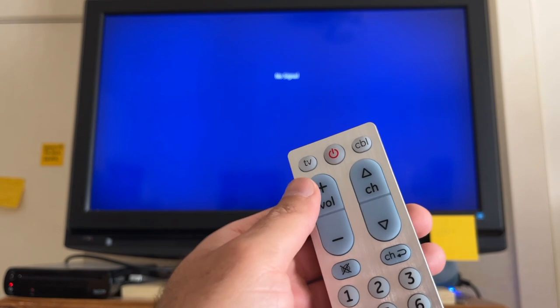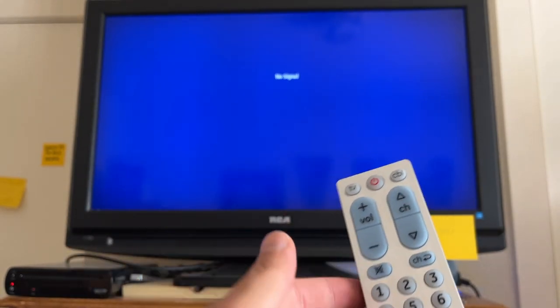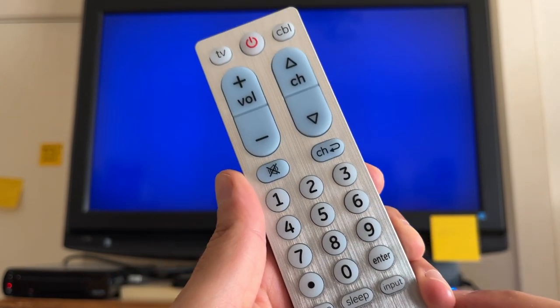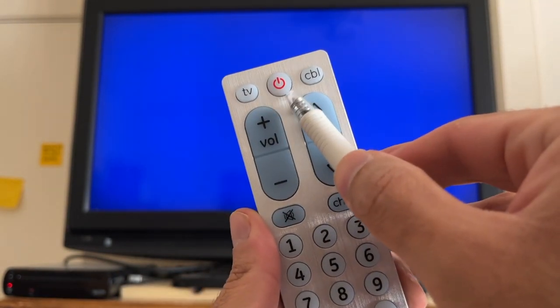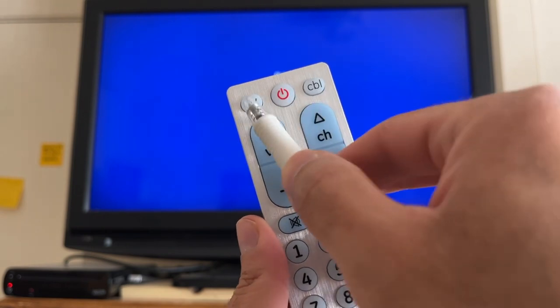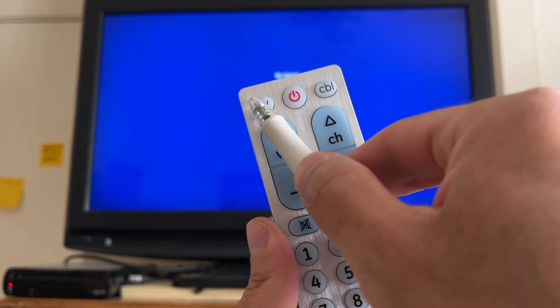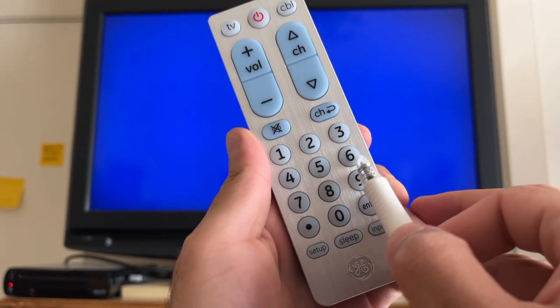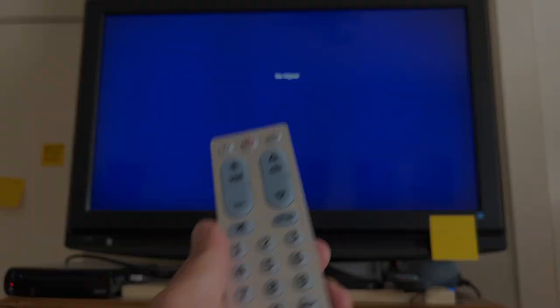And that's it. So this works. So that's how you do that. So again, you press and hold the setup key until this lights up. Then choose a button. I chose TV. I press it. It flashes once. Then I type in my 4-digit code and it's programmed.